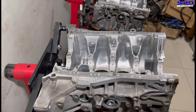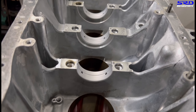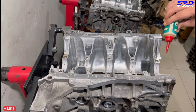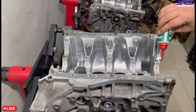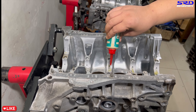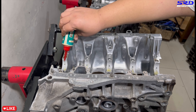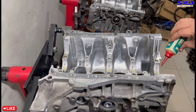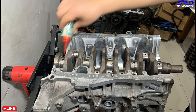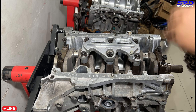We're going to oil this with regular 30-weight oil. Just to show you guys — of course when we do the final assembly we'll use assembly lube. Here is the 30-weight oil; oil it up really good so we can show you how the crank turns with just simple assembly like this. The crank is also micro polished. Now we drop in the crank, add the side thrust washers, oil them, then fit the caps — hand tight, keeping it snug.